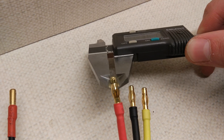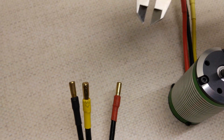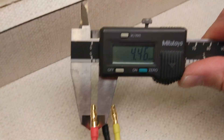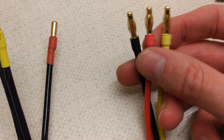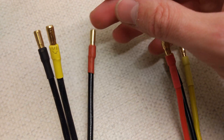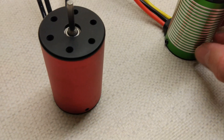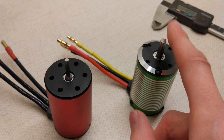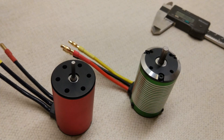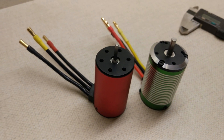Let me grab these banana connectors — so that's 3.5mm, and this one is 4.3mm. Interesting. I think the banana connectors splay out more — yeah, they're about 4.5mm as well. This is why I don't like the banana connectors, because they don't seem quite as grippy as the bullets. But then the wires on the Surpass are that rubbery stuff, whereas the X-Team has the silicone stuff. So the X-Team has better wires and the Surpass has better bullets. You can get the X-Team with a 5mm shaft and the Surpass with a 3-point-whatever millimetre shaft — take your pick. I'll be doing both of their performance tests in the Team Magic, and I'll see you in that video. Goodbye.